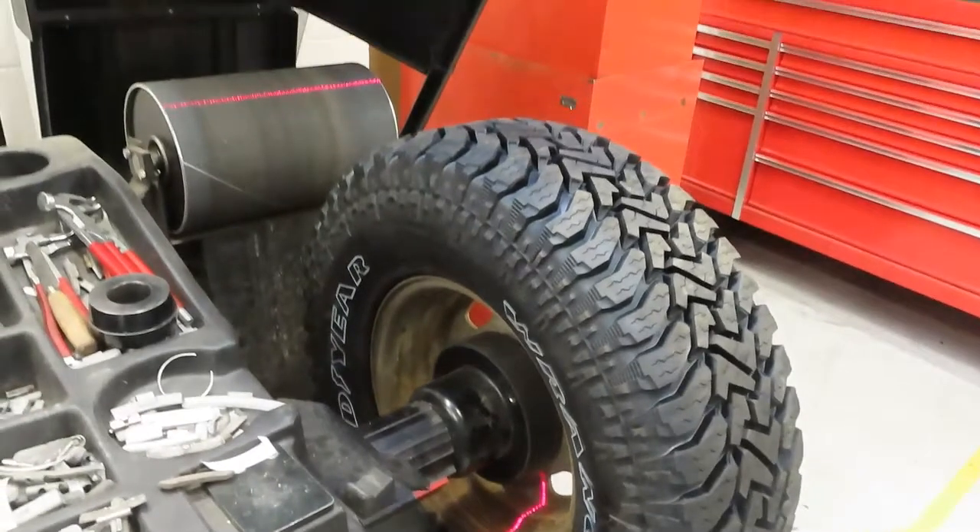Please keep in mind how to properly mount a wheel to this tire balancer. What I've seen in the past is nine out of ten times when someone is using excessive weights — a whole lot of lead — or they think the wheel is bent, in reality they've not mounted the wheel assembly to the machine properly. Have a good day.